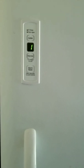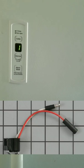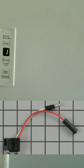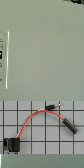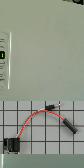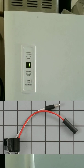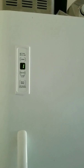The second problem might be the defrost thermostat. It's interesting, because you would think it either works or it doesn't, but that may not be the case. It's possible that the defrost thermostat is not opening the circuit at the correct temperature — it may be opening at a much colder temperature than it should. Testing the defrost thermostat correctly is important as well, and I can share a link to that below.